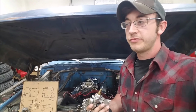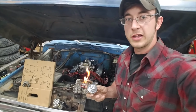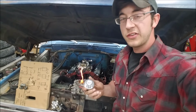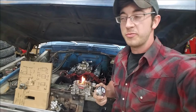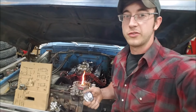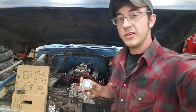And, you know, it's worked out pretty well for me in the past. Now this is the other style of fuel pressure regulator that you'll see out there on the market, this dial style. And I'm not the biggest fan of these. Oftentimes they start to leak right around the dial, right onto your intake manifold or where you have it, and peel all your engine paint off. In extreme cases, it causes engine fires, which no one really wants to have. So I generally try and avoid these.